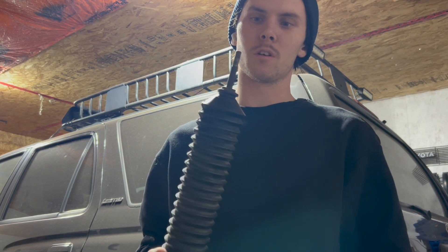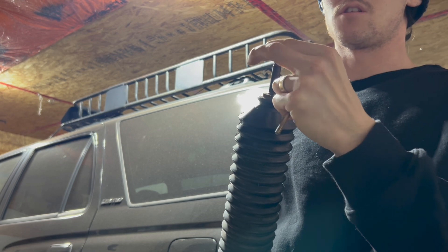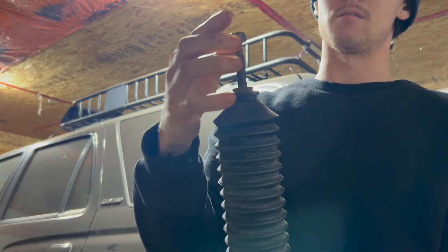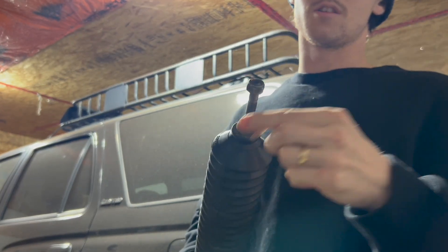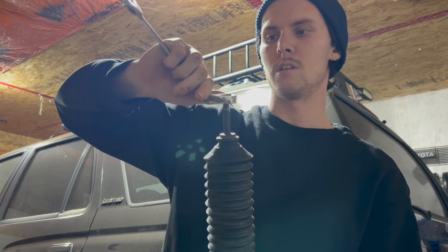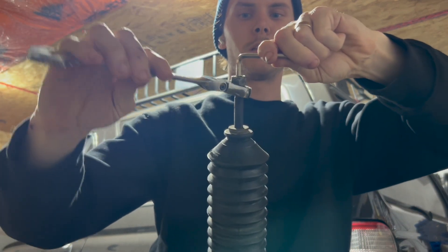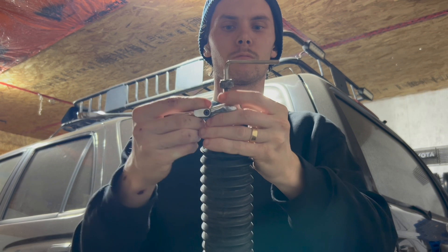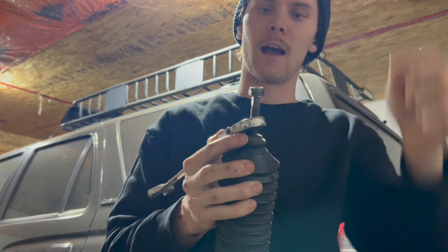The shocks are out, and here's what is so difficult. You've got a 17mm nylon lock nut — if you just take a wrench and spin it, the whole shock shaft spins and you get nowhere. What you need to do is use the allen on the top of the shock shaft. You get your flex head ratchet on there because that's the only thing that can actually reach it, then get your allen in and spin the nut off — all with one hand. In my case there was rust on the threads so it took so much force that it actually rounded out the allen.